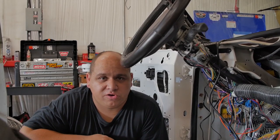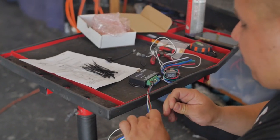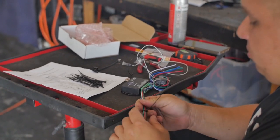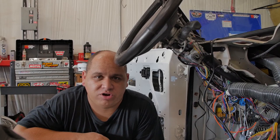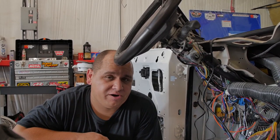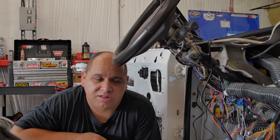Currently we're doing the remote start — alarm remote start — and it's done on a Viper aftermarket unit. I have to intercept all the factory wires, figure out my ignition, my accessory, so that when he hits remote start all his gauges come on, AC comes on, and it becomes either a nice hot truck or a nice cool truck depending on the weather. With any of these older vehicles it's a challenge. There's always things that come up trying to find wire intercepts and trying to figure out colors that either aren't there or have to trace back wiring to figure out where it originates. It gets difficult.